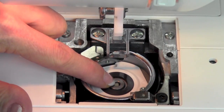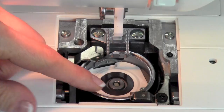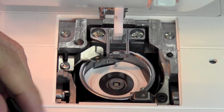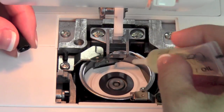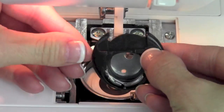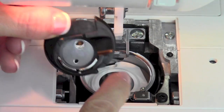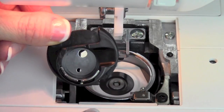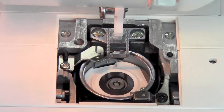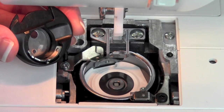Right down the middle is a little bit of a wick. In your manual it doesn't talk about oiling the machine, just cleaning it, but talk to any mechanic and they will tell you a little drop of oil down the middle of that wick will draw it to where it needs to go. Back to this bobbin case — you see this really large hole down in the middle? There are two holes but one's larger. That sits directly over that wick that I just added oil to. You have no excuse whatsoever to add a little oil to your machine. I usually find myself cleaning the machine and giving a little drop of oil when I break a thread.